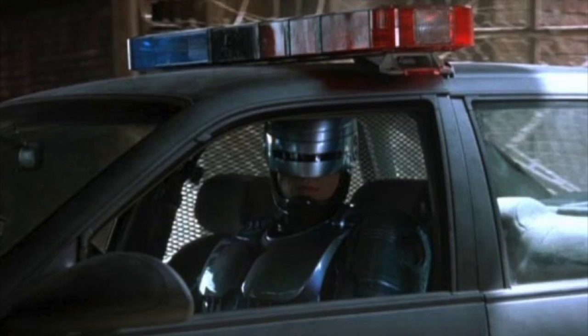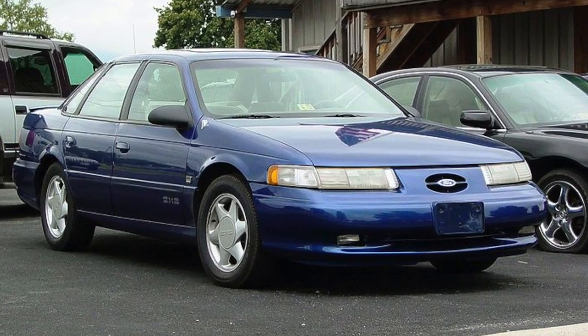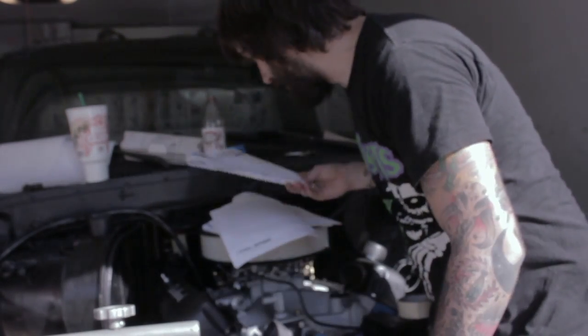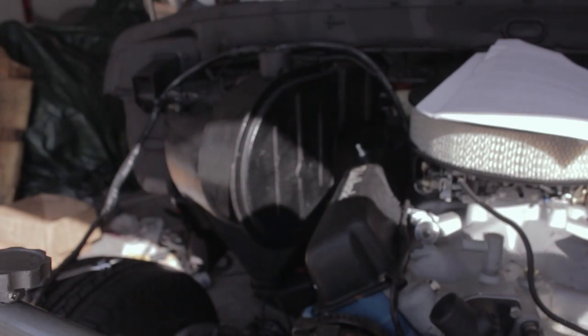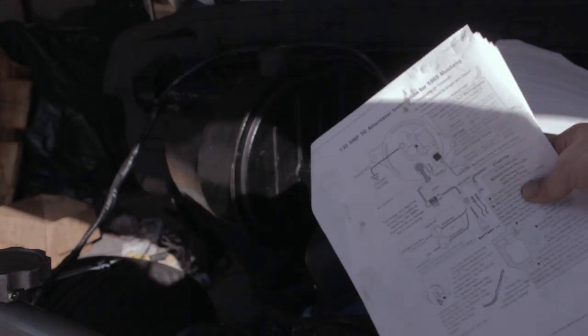The best place to find these — I got my information from a forum — is from Ford Tauruses: some 1990, any 1991 or 1992, and some 1993 through 1999 non-dual overhead cam Ford Taurus should have the right spacing and the right size. If you want the 130 amp one versus the 95 amp one, that's when you look for the one that has two holes versus four in that section I showed you.